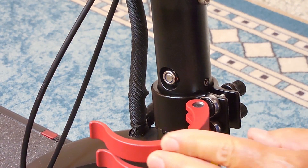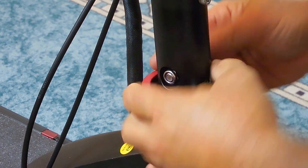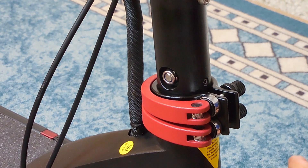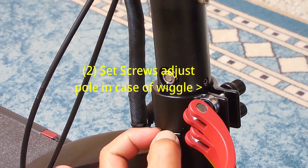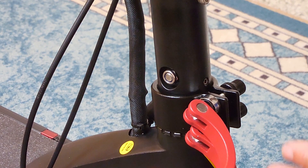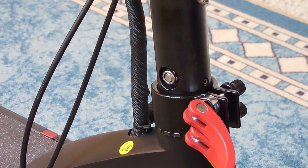When the clamps match up, just push all the way until it locks and push both down. After riding the scooter for a while, always make sure that the sleeve did not move upward because the clamps were not tight enough — check the spacing right here. If there's a space, that means it's slowly moving up. You do not want that to happen because if you're riding and the handlebar tilts towards you, you can lose control and get hurt. Always double check this area after riding for a long time.